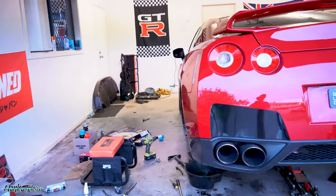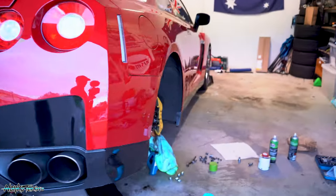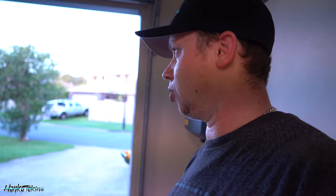Okay, so the rear — it's been a long day. The rear rotor hats are now in the oven. It's going to help bake the high heat paint on there quicker. Once they're done, they'll stay there for about 10 to 15 minutes. Then I'll pull them out, give them a lick of the orange anodised colour. In the meantime, while I'm waiting for them to dry, I'm going to do a bit of a tidy up just so it makes it easier once I'm done. So they've been painted, in the oven to cure a bit quicker, and then I'll put the orange paint on a little bit later.